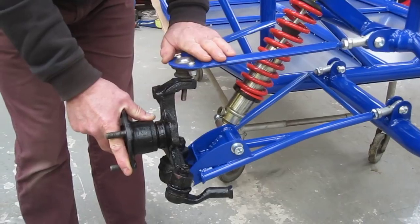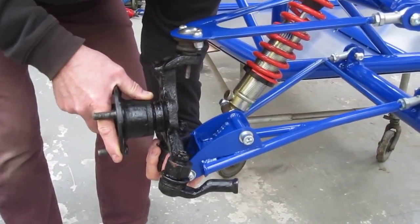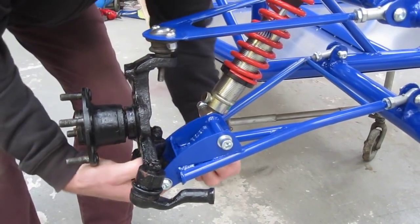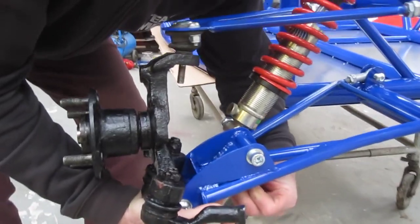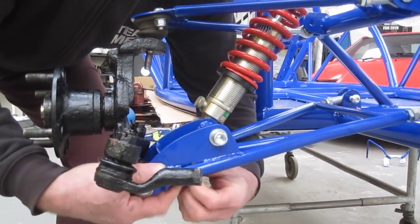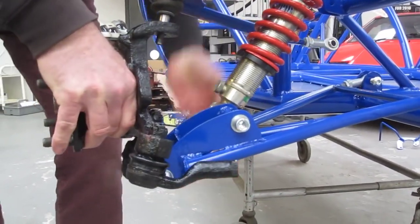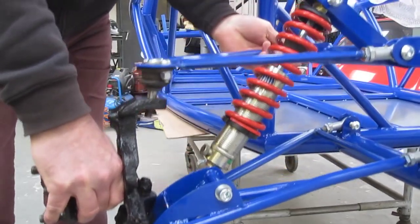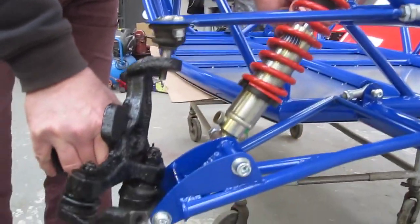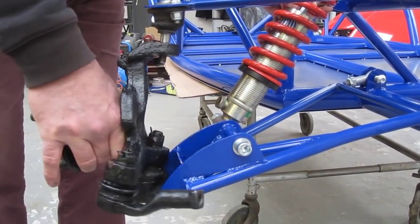In this particular car, it's quite easy to solve. All we've got to do is rotate the bottom ball joint assembly on the main pin. We'll put a couple of packing washers in the space there and bolt it up later. Just to prove the point, I'll put one washer in and load that into place. Then when we try to locate the wishbone at the top again into its proper place, it goes in without binding, and we've got full travel left to right lock on the steering.